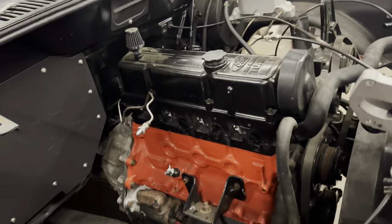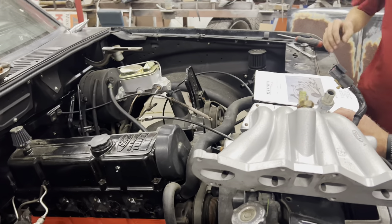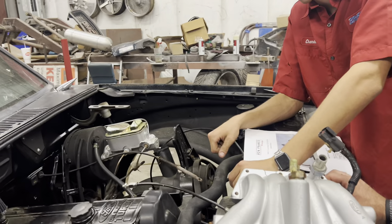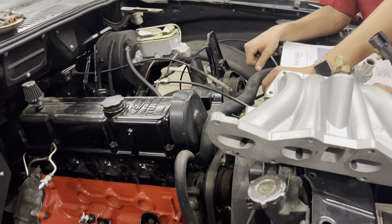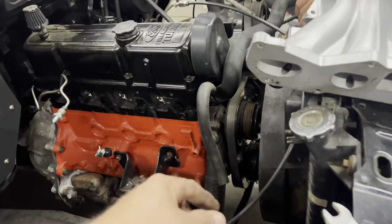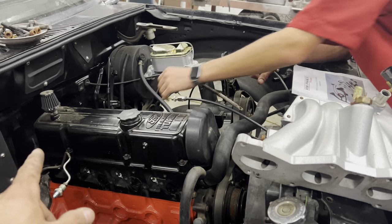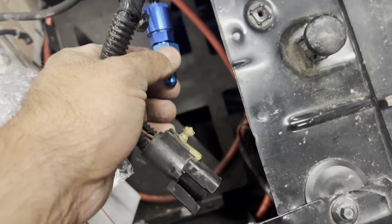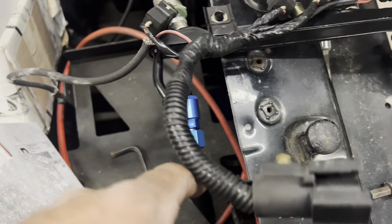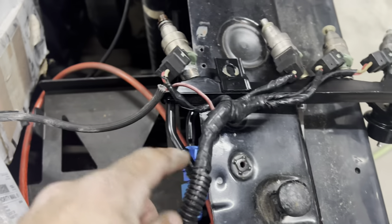We've got the motor stripped down and we'll start putting gaskets in. The harness instructions say to remove the intake before you run the harness so you can get everything routed, and then once the wires are run and you know where they all go, you start putting it back together. You route the ends as you go because there are sensors here, sensors there, sensors on the other side. We've also got to build an oil drain hose that goes up to the bottom of the turbo, put hose clamps on everything since nothing has hose clamps, run a catch can, and run a hose from the valve cover through the catch can which is mounted on the fender.